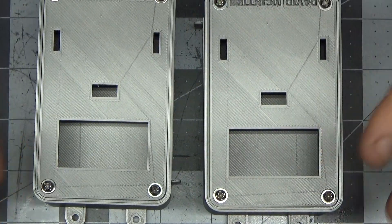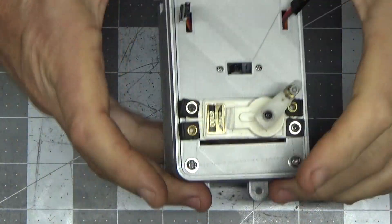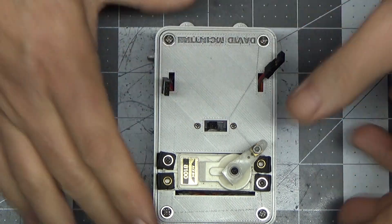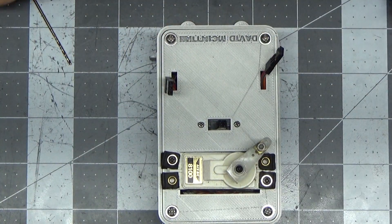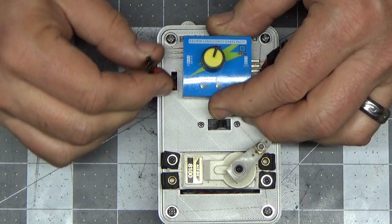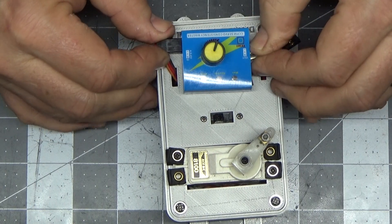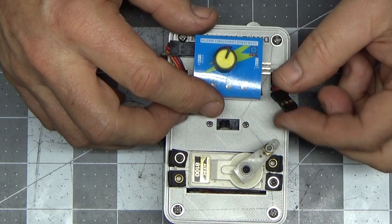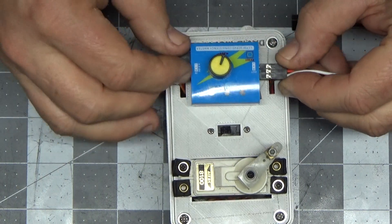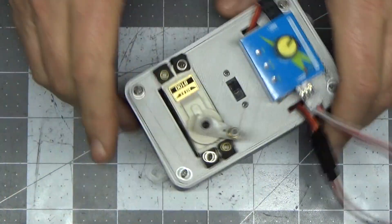Can't wait to get one of these things set up — transfer those components and put them inside here. I went ahead and threw my same Ace servo in there because it already had the throttle arm in it. Drilled a couple of holes here for my switch, so my switch works. Still got a little bit of double-sided tape on this thing so I can just kind of drop this on here. I like these nice little openings here for the connection leads. My switch is on and it works. I've got my Y connector here, and this guy plugs into here. Now this thing is ready to rock and roll.